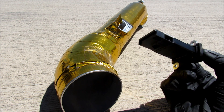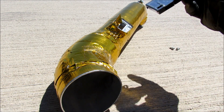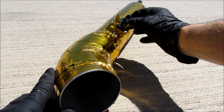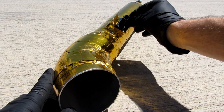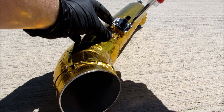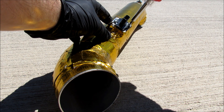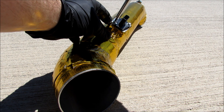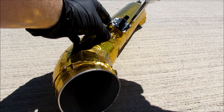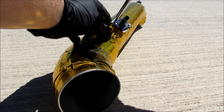Make sure you reinstall the mass airflow sensor in the correct direction. Since air flows in this direction, the hot wire faces this way — there's no airflow on the back side. Gently slide it in the correct direction. Finger-tighten each screw on both sides first, then tighten each side equally so there's equal pressure on both sides — that's a good rule of thumb instead of torquing one side down fully before starting the other. You don't have to torque these very tight at all, just snug — they already have washers on them.